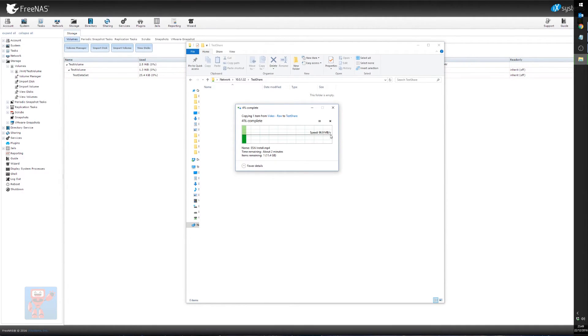So we go back and change the permissions, granting them to gaitp\gaitp — my domain account — and domain users. Then when we go in here this time and try to drag a file across, you'll notice it works absolutely fine. With absolutely no optimizations whatsoever, we are pulling in around 90-95 megabytes per second. We could do more than that — we're going to look at some benchmarks later to see how we can improve that. But for now that's pretty good for absolutely no optimizations done so far apart from turning off compression.